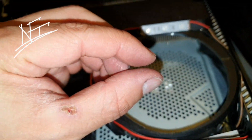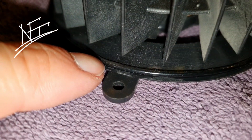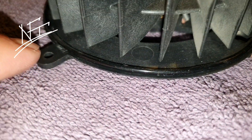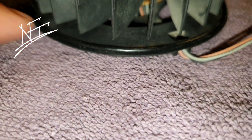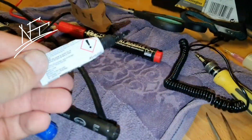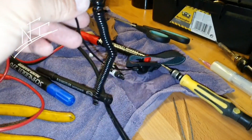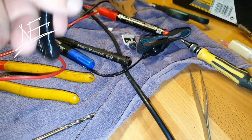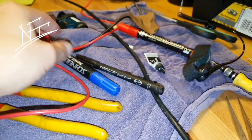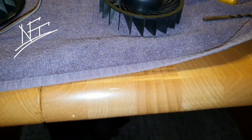It's just about one millimeter that's missing. So on the PlayStation 3 fan, where I've cut the small pieces out, I need to glue a thin black cable all the way around using super glue. I used solder wire from an electronics kit — cost maybe 50 cents or one euro. Other cables were too thick, but this one was just perfect.